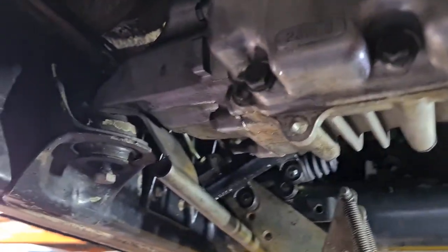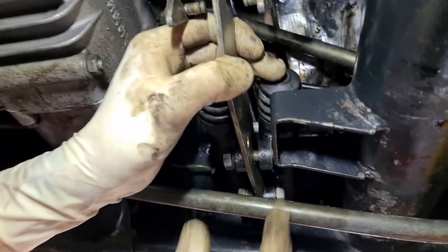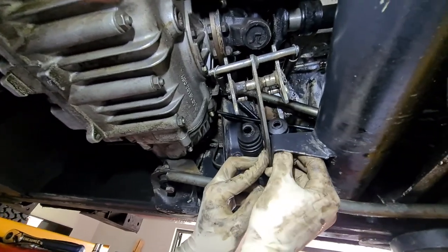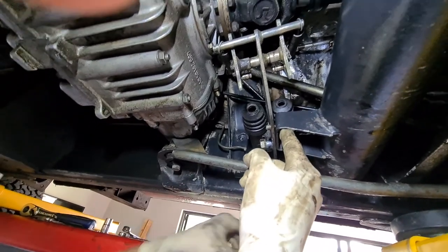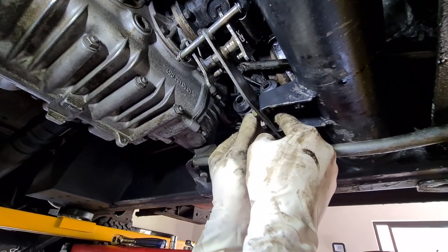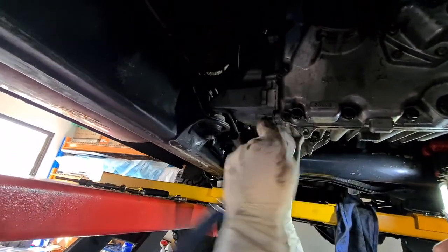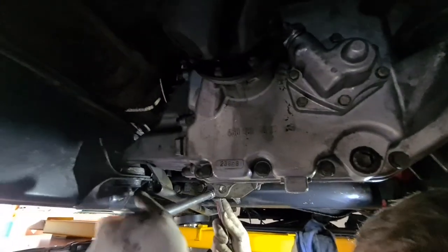The brackets are going back in, and this is where that silver piece played in — because after I reinstalled it all, the actual mounting was pushed towards the rear of the car a little bit. That actually makes enough of a difference that getting the front brake line on is bloody hard, and that carries over to the rear brake line too. So just pay attention if you're using a new one; if you're using your old one with a repair kit it won't be a problem. Here I am putting the 13s and 17s back on and putting it all back together.